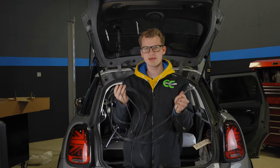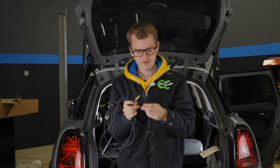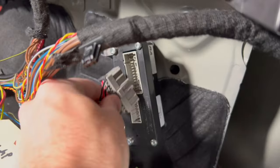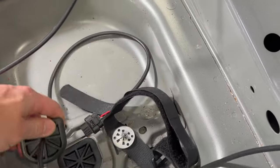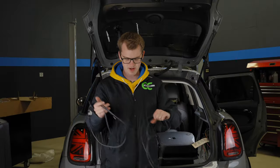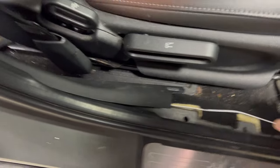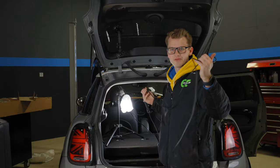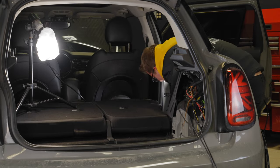All these wires that come in the kit make up wiring harness F. We're going to plug one plug into the receiver we just installed in the car. The little grommet goes down to the bottom of the boot so you can route it down there, and this long cable gets routed to the front of the car. We have the wire plugged in and grounded — now we'll route it to the very front using a coat hanger to pull it through easily.